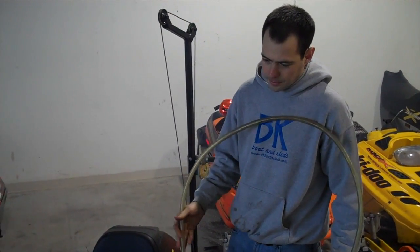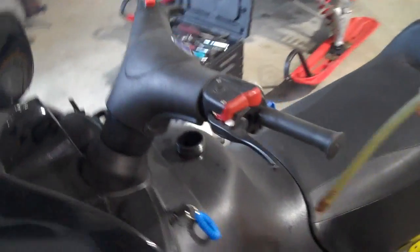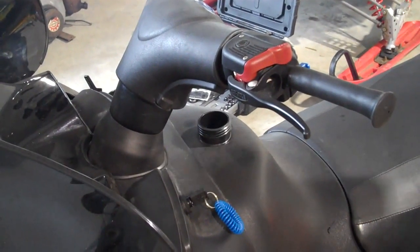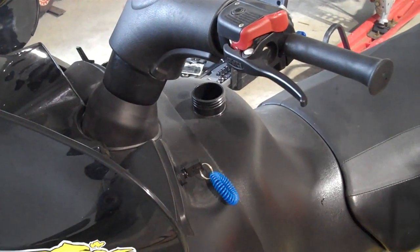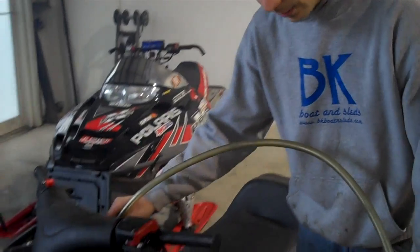After you've got it running and warmed up, the next step I like to do is drain the gas out of it. Nowadays the sleds mostly have plastic tanks, so there's really no need to keep the gas in it. A lot of guys like to keep gas in it, but if you do I would use something called Sea Foam to stabilize it. But in my opinion you're better off with no fuel in it — it doesn't gel up, doesn't turn to varnish. Just get it out of the sled and out of the equation.